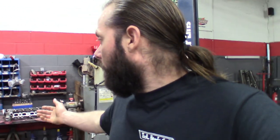So that's it, guys. Again, I'll leave the link to the Lisle tool down in the description. Pretty great tool. It's really great for taking the valves out, for uninstalling the keepers and all that stuff. As far as installing them, it's only great for, like I said, a head like that where the springs are sunken down into the head. It's better than using those compression valve tools.